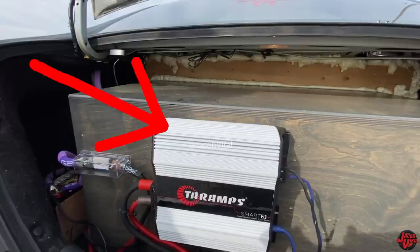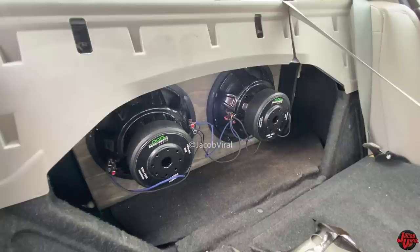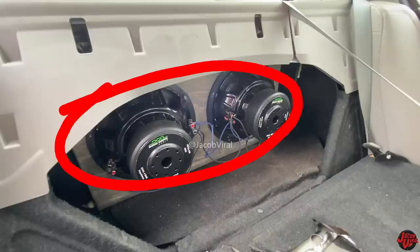And he's running an efficient 3000 watt amplifier on two 600-watt subs, which gives a really efficient power to sub ratio. And lastly, inverting the subs gave him a little bit more box space. Anybody with a small box, try inverting it. It might give you a little more output. Anyway, that's all I got to say.